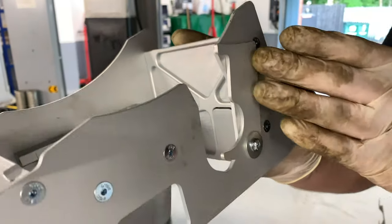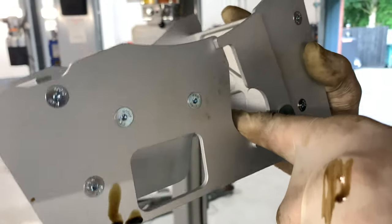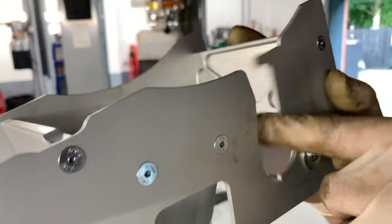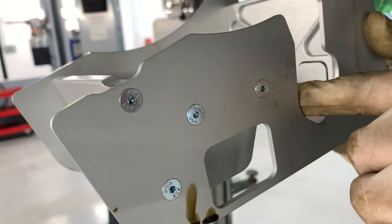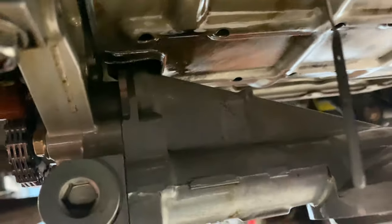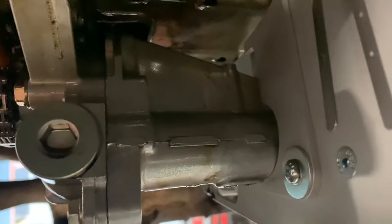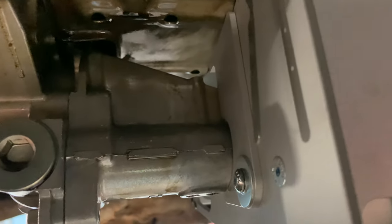So, as you push up, you baffle. Your oil pump, oil pickup pipe up here, sits into here and basically it locks itself around. So we were trying to figure out how far it's supposed to lock round. It actually locks to about there. So you've got the rounded part, and then it ends up in the flat plate in there. So as it comes up, it just locks around. Absolutely beautiful fit. That's really good design.